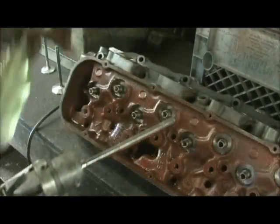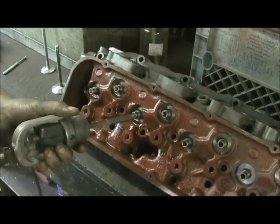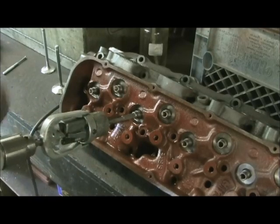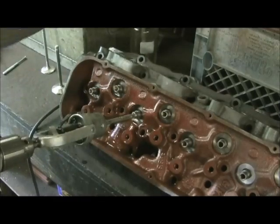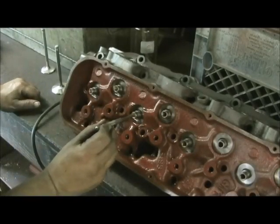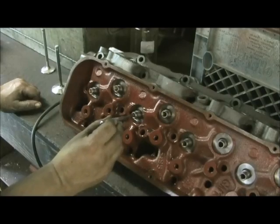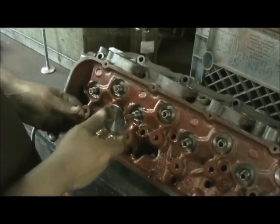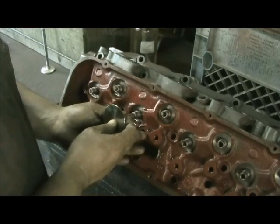I take my guide hone and shoot just a touch of WD on there. I put it in, tighten it up just a little bit, and notice that what I'm doing is just trying to hit the top. I pull the hone out after that — I didn't even go all the way down. Now I take the hole gauge again. It's got the same pull all the way up and down, so we didn't need to go all the way through. To confirm, I'll take the valve — man, that is just absolutely perfect. The key to the valve job is the straightness and tightness of the guide.